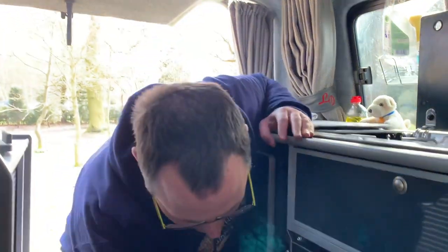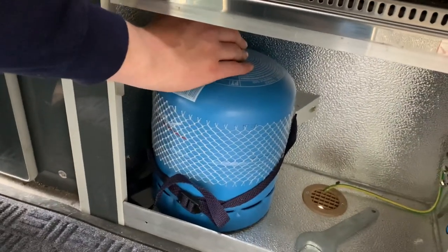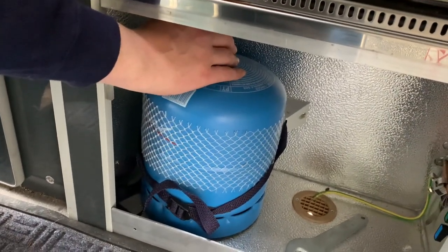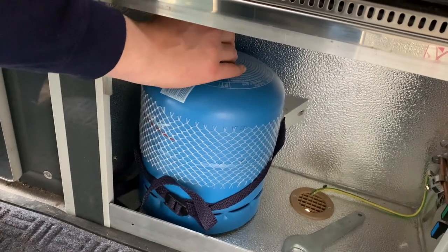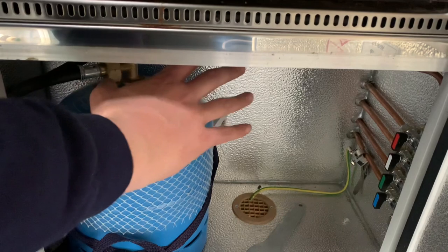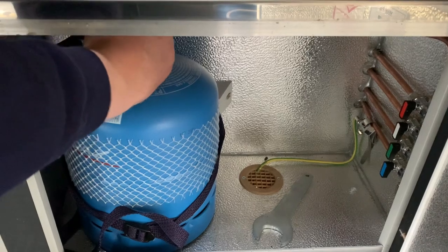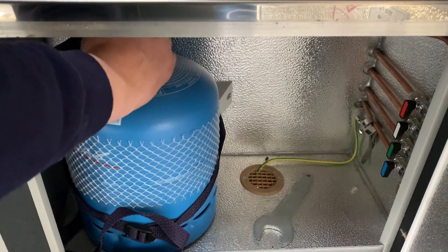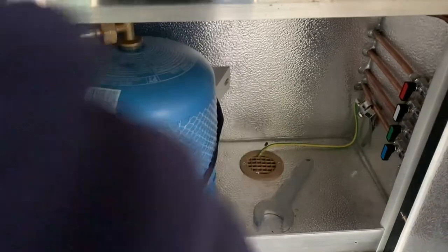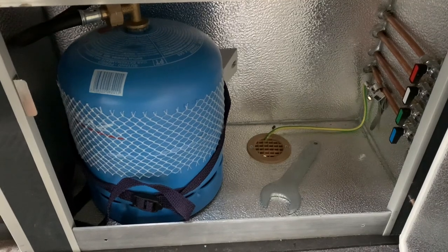So, gas and cooking. Our gas comes from a large camping gas canister — actually the biggest you can get. That powers the fridge, the oven, the hob, and the grill. You've got a couple of isolating valves so we can isolate any one of those from down in the cupboard. One important thing to note is you cannot drive with the gas switched on — it must always be turned off on top of the bottle. You've also got a vent down there so that should we ever have a gas leak, the gas will sink down and out of the vehicle without poisoning us.